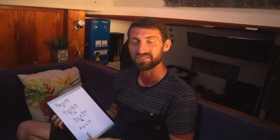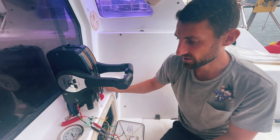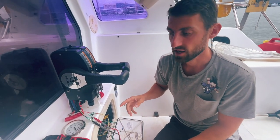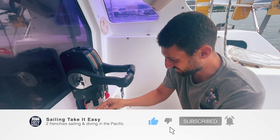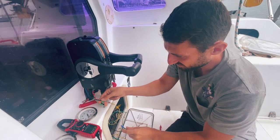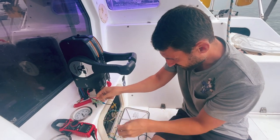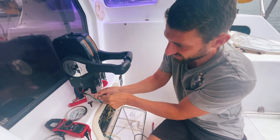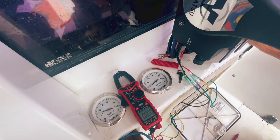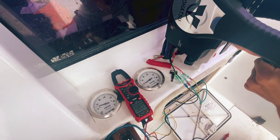Let's see if it's that easy when we actually do the measurements. We have 95 hertz on the readings, so when we plug the tachometer we should see around 1000 RPM. Let's give it a go - black into black, green with white. And we have 1000 RPM! Let's give it a little bit of throttle and try to get to 2000.